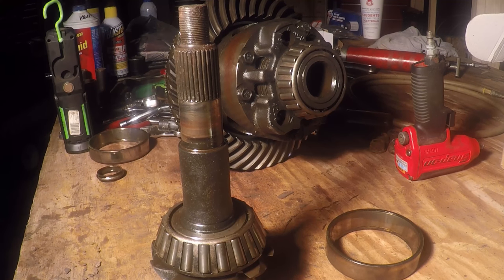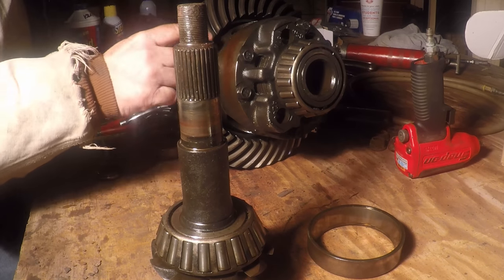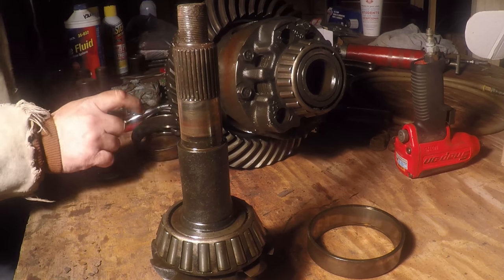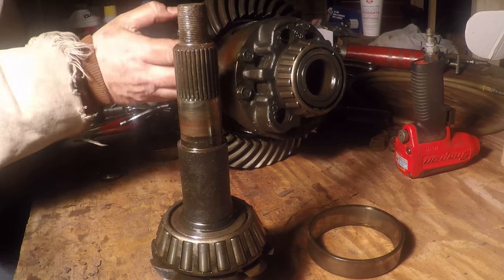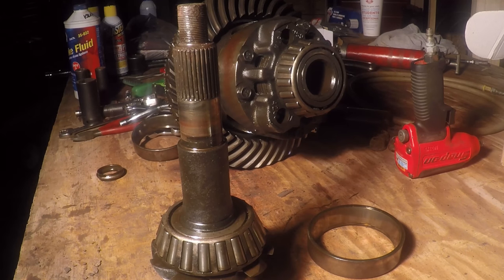If it's too much money I'll probably find a used rear end, pull the cover, go through it, make sure it's okay, and change what we need to. I'd really prefer to do the ring and pinion properly, but it's a fear of the unknown — never done it before. I'm also seeing signs that someone else has been in here before — there are dot stamps on the carrier, maybe from replacing clutches. Alright, once we figure out what we're doing, I'll bring you back.